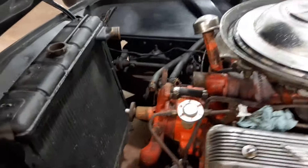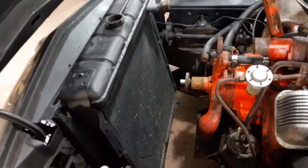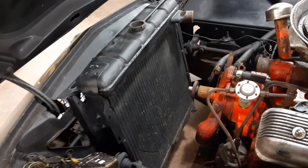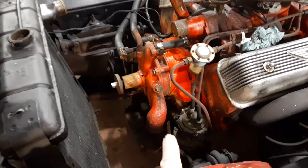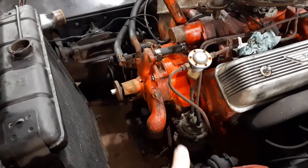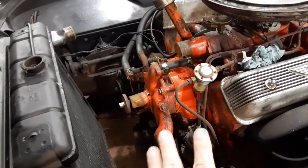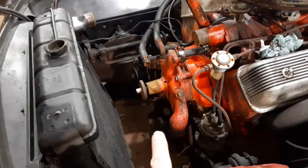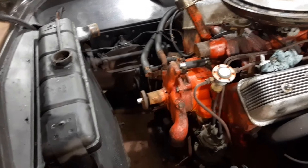Also got the fan off and the hoses off the radiator. There are only four bolts on the radiator — two here and two on the other side — then I'll take it to a radiator shop to have it tested. We are preparing to disassemble the front; I might also buy a new water pump spacer that has a better flow pattern. All of that has to come off so we can do the harmonic balancer, which is one of the long poles in the tent. I have it, but it's quite a bit of work — once that's done it'll be a big step forward.